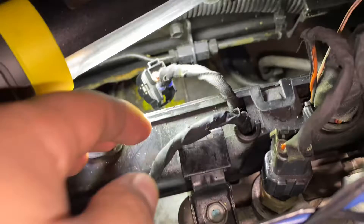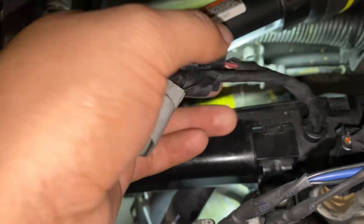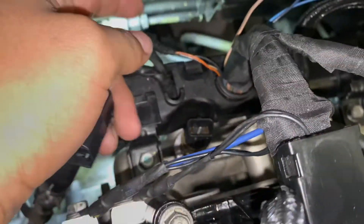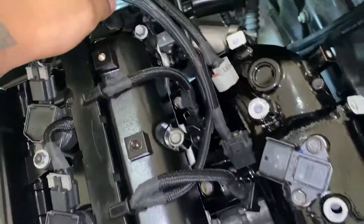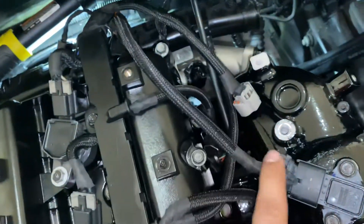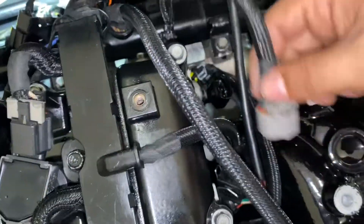I have these two sensors right here — both are for the O2 sensors, one for downstream and one for upstream — but I don't use these so I'm just gonna tuck them away or probably cut them later. This sensor right here goes to your coolant temp sensor, but before I plug it in I'm going to redo some of the harness on it. This is your OEM MAP sensor and IAT sensor — I just pulled the wires out and redirected them to look cleaner. You also have a cam sensor back here — plug this one in.